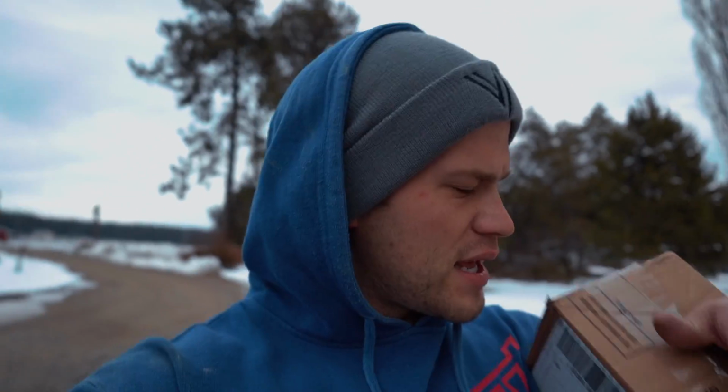So let's go ahead and get this fuel pump installed. I know we have to mod out the hanger quite a bit on this car to get this fuel pump in here. I'm currently running the Walbro 255, but being that I'm going with quite a bit bigger of a turbo, I do need a new fuel pump. Injectors should be fine. I think those are ID 1050Xs, so those should be okay for pump gas. Just the Walbro 255 is way too small for what we're gonna be doing.